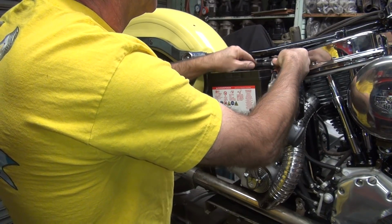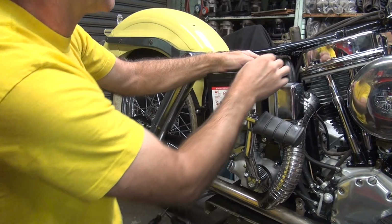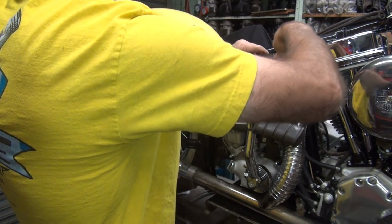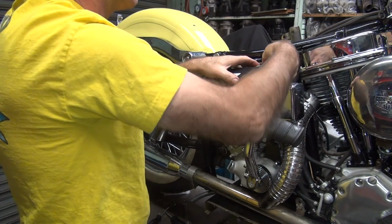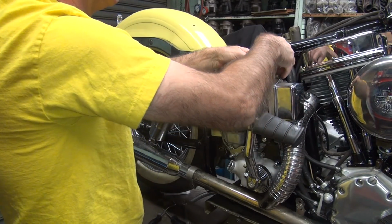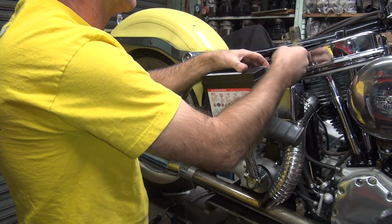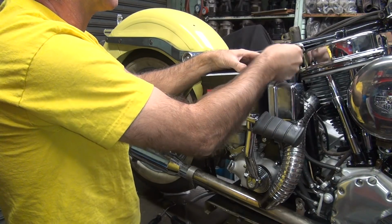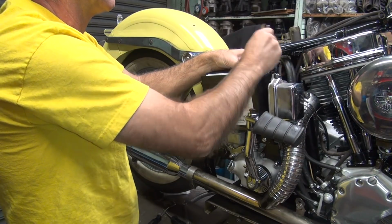So he uses this battery in lots of different things. All the EVO 5-speed batteries have this one in there, or Sportsters. So, multiple applications you come across. Even some jet bikes use the same battery. So you're not locked into just one thing. The disadvantage is you got more cable back there to get tangled up in something, possibly. But that's why I protected it with conduit.